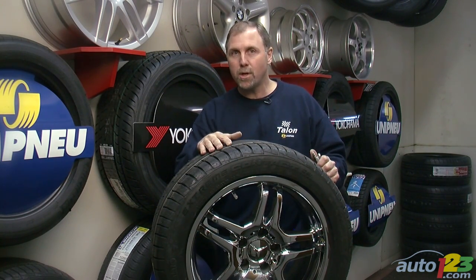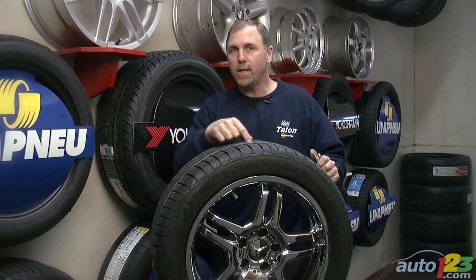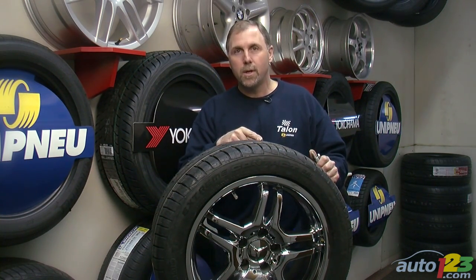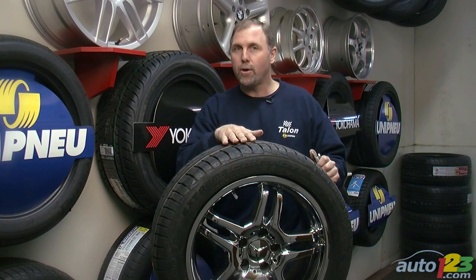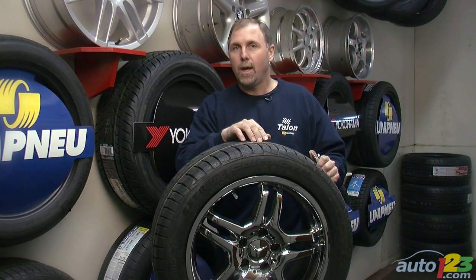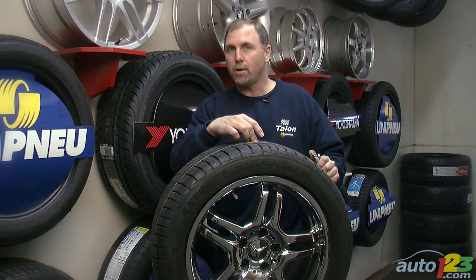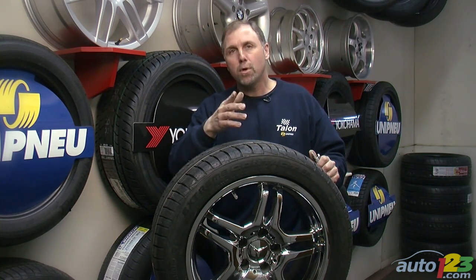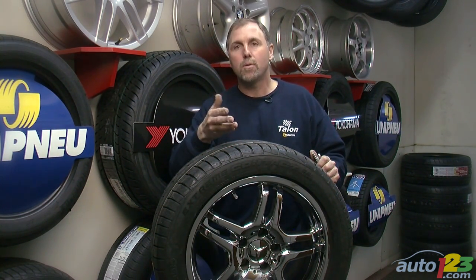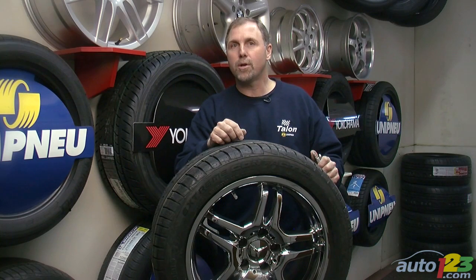And when a tire is mounted on a rim, we get what's often called stack tolerance. In other words, a tire might have a slight imbalance in the distribution of its weight, and so does the rim. So what happens is if you have a heavy point of a tire aligned with a heavy point of a rim, you end up with a higher amount of imbalance. And when the tire is in rotation, a small amount of weight at the exterior of its diameter has a fairly noticeable effect on its ride quality. I think everybody's experienced a shimmy from time to time in their car